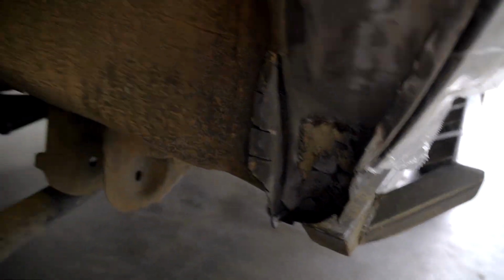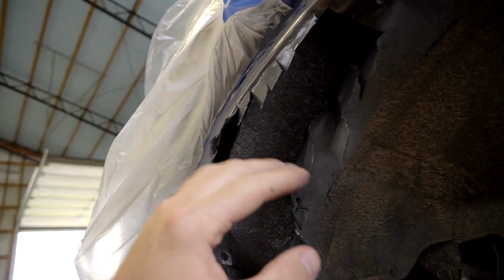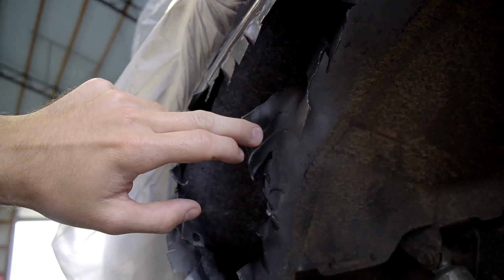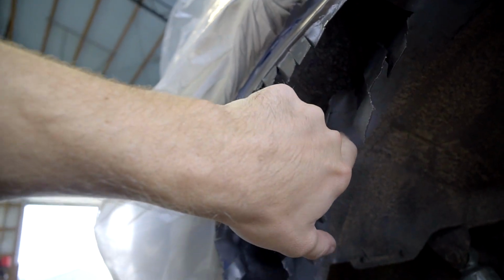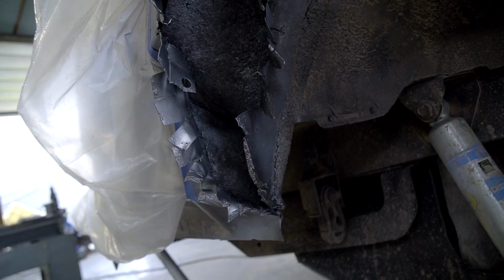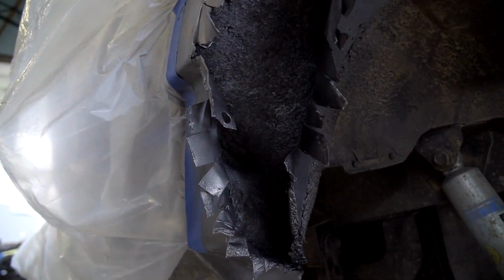We're gonna be doing that weld, and you'll see here in a second we're gonna be welding up sheets right here too. So that's another reason I want to paint this side, because that will be tucked under the metal that we're painting. So just make sure everything that is gonna be exposed, or any exposed metal, is covered.